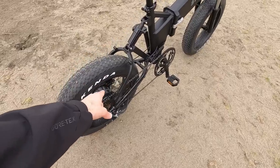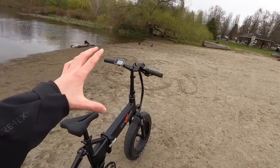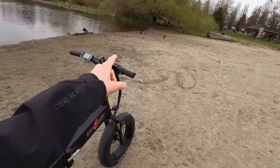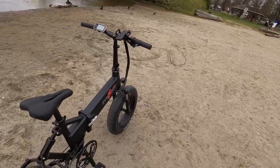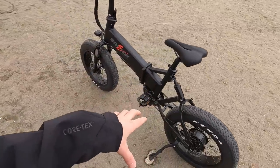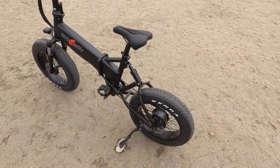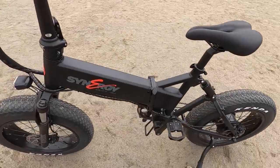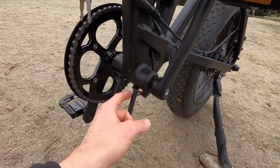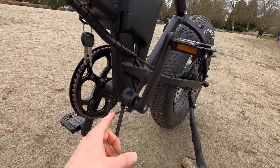For the most part with this motor, the bike is very powerful and set up to be pretty zippy. In the higher levels of assist it really takes off. The throttle is active and will override pedal assist in levels one through five. I never found myself really struggling — I'd just frequently jump to the throttle rather than trying to pedal my way through. It starts in pedal assist one, so be careful: if you turn it on and touch the throttle, it could take off on you.